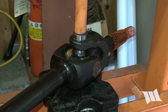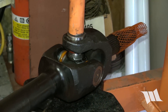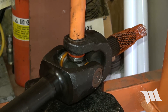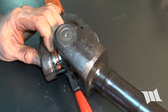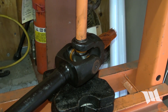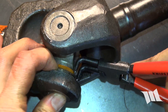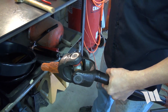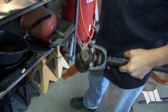You can now press everything in. Once the upper bearing cap reveals its groove, remove it from the press and secure it in place with a full circle clip. Finish pressing in the last bearing cap and secure it as well. Take a hammer and give each side of the stub shaft a solid whack or two, then check to make sure that everything moves freely.